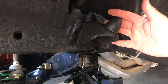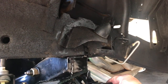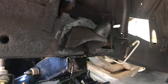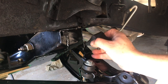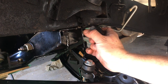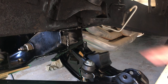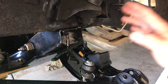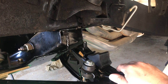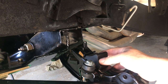Something else I should mention: the reason you don't need to cut the top ones — actually, you don't have to cut any of these if you don't want to, including the bottom one. I cut the bottom one because I like my cars really low. Usually when I drop my Mopars, it's right about here, just about to hit the frame. By cutting this off, it gives me a little bit of distance between the bump stop and the frame so the suspension can move a bit as you're driving. It's my mom's car — I don't want it slammed low. I'm probably going to give it a one inch drop all the way around. Probably don't have to cut these, but I'll cut it anyway just as a little security blanket to give it a little bit of extra space to travel.